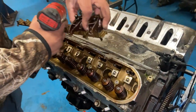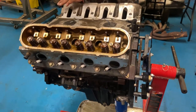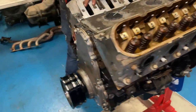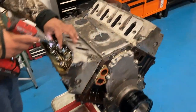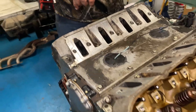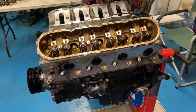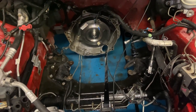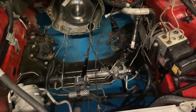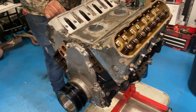So the motor's out and we're taking off the rocker arms and the heads — one, to determine whether it's an LQ4 or LQ9, and also to clean the remainder of the block. We already pressure washed it to knock off a lot of the grease. The bottom of the block is clean, so is the oil pan. Since we're not going to use these heads, we'll remove them and start prepping the block for the new cam, oil pump, trunion kit, springs, heads, and intake. We already took care of pressure washing the engine bay — you can see the rack and pinion is visible, so that's a sign it's clean.